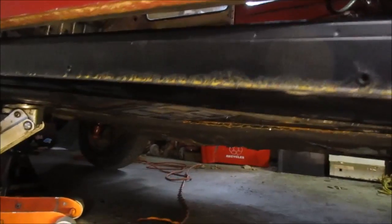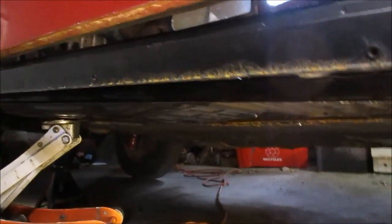All right, so after much finesse and deliberation — going from this spot right here at the front of the car, that's where the heater channel should be. Looking at where the bolt holes line up for where the pan is, I need to take about a quarter of an inch off the back of the pan. So I'm going to take apart this puzzle that took me a couple of hours to put together one more time — however many more times it takes before I get it right — and we'll get her fit back up in there.